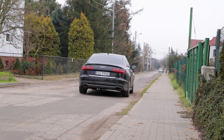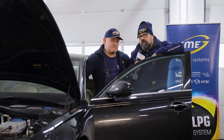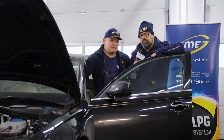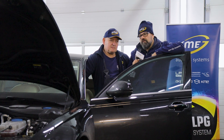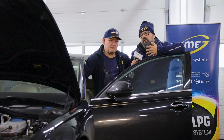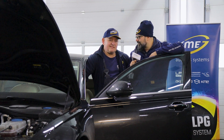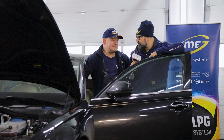Since we're filming this at the turn of November and December, it's already cold, and you should know that winter gas has a higher propane content — 60% propane and 40% butane. Summer gas is the reverse. That's why in winter the car will always burn slightly more gas. Our controllers will optimally tune the mixture, but winter always causes a longer warm-up phase. Gas also has lower calorific value but better gas pressure, because butane gives more kick — as I always explain, a better boot comes from butane, but when it's cold, butane doesn't want to vaporize.